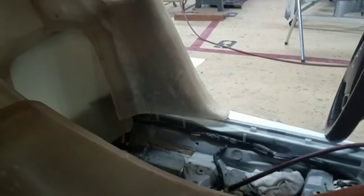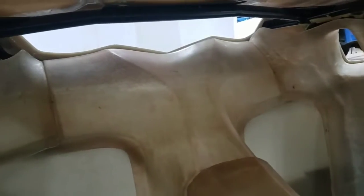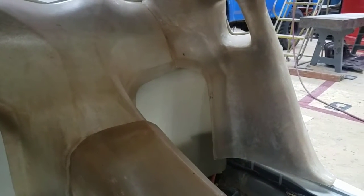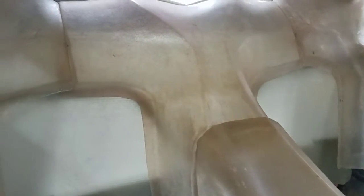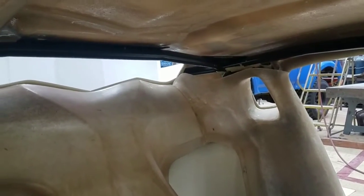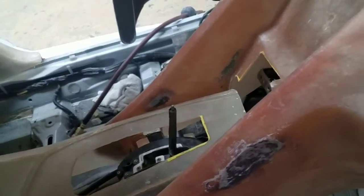And then we've got the back pieces temporarily in place just to kind of see where they're going to go, get them fitted, cut, trimmed. They look pretty good. Got a couple temporary little screws in them to hold them. Going to paint the back piece with some undercoat, and then I'm going to put some Dynamat behind it on the inside, so it should soundproof it pretty well. I'm going to also Dynamat the inside of these panels in here as well, so those will all be Dynamated. Roof will be Dynamated, ceiling, floors, everything, doors. Should be pretty quiet. So that's where we're at for temporary hookups.